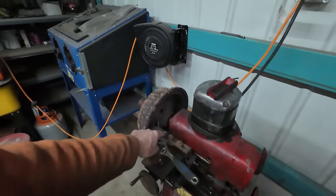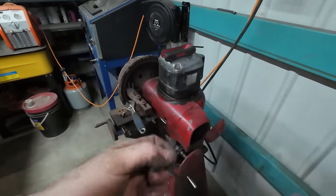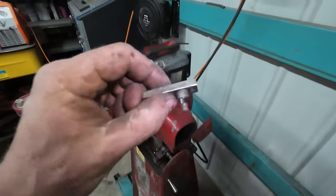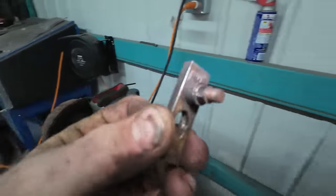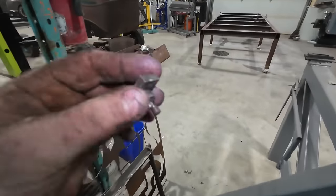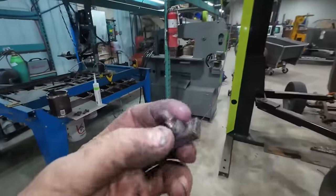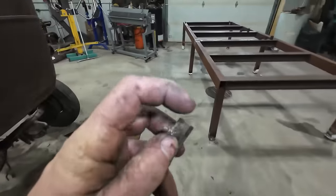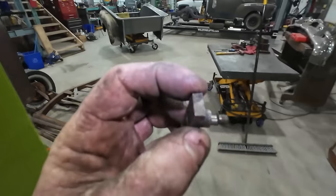All right. Well, we've been working on here. She's not quite auto-feeding by herself so much. This thing's not doing a full swing, I kind of noticed. So I pulled it apart, and it kind of looks like we got something a little bit worn out in here. My lathe doesn't have a four-jaw, so I can't really pull that out. But we're going to just fill this thing up with some brass, and we'll try to shave it the best that we can, and we'll stick it back in and see if we can continue working our brakes there.